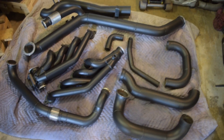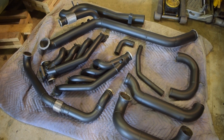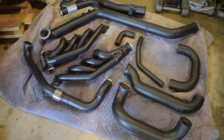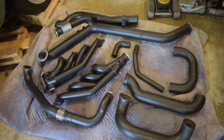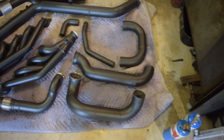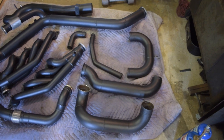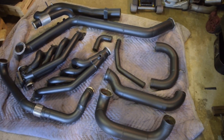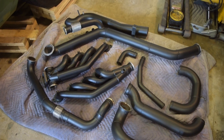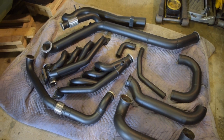About five days later, these parts have been air curing as part of the Cerakote C-Series system — super high temp, up to 1800°F, but air dry so you don't have to cure it in an oven. Initial durability test with an X-Acto blade on an area that will be covered by a hose — it seems pretty durable. This is totally my first time doing this, but super pleased with the way it turned out, and it looks like it's going to hold up well.